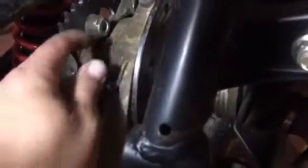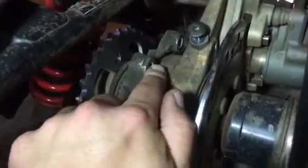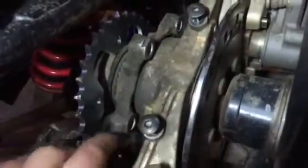And you will notice two Allen bolts here, 1, 2. Undo those, and that's where the splash guard sits for this guy. That allowed me to undo the bolts for your rear sprocket. All I did was I rotated the sprocket, took one bolt out at a time, and rotated this side of the way, rotated him up in this area. Gave me plenty of room to get a wrench on the outside here, and my Allen key in here. I had plenty of room to work, so that wasn't too bad.